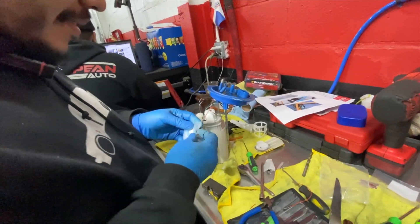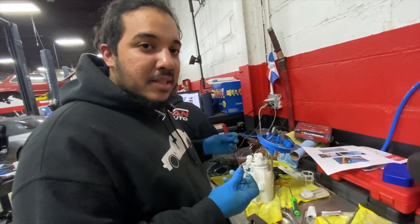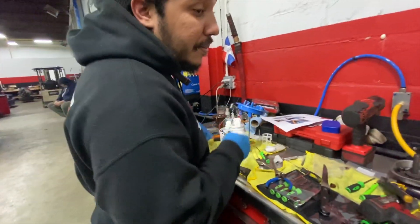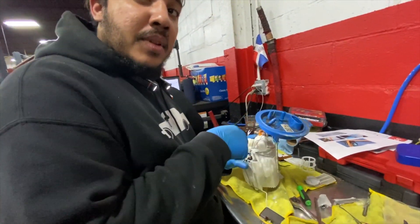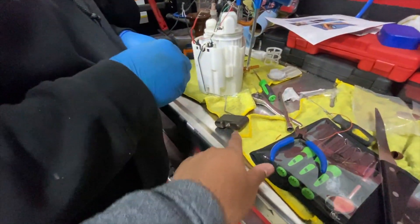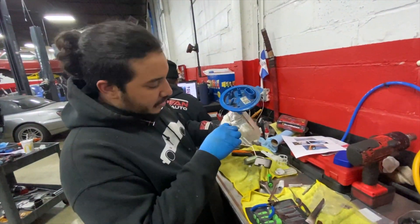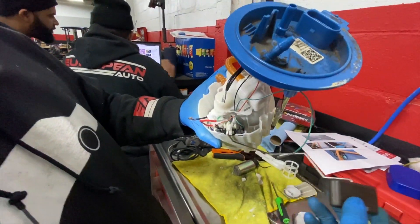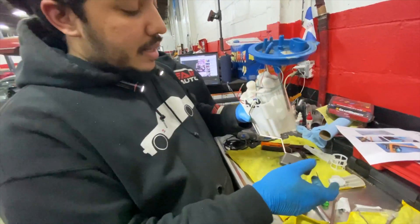After this he's going to go back into the gas tank, put it back in, and seal everything up. It's pretty much an easy install — you don't need much. The only hard part was the way the Walbro pump orientation, like fitting it in. That was the only hard part, but they give you the drill piece. This is the fuel level sender right here — the weight. You see the notch that we did earlier? It clears because the pump is higher up.